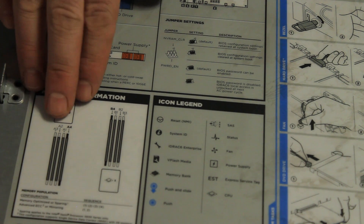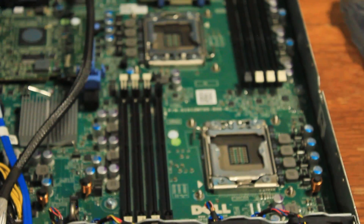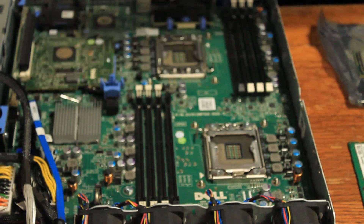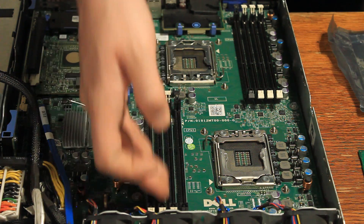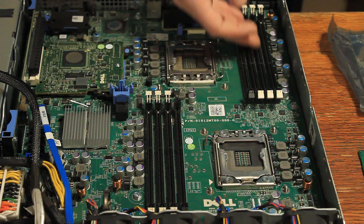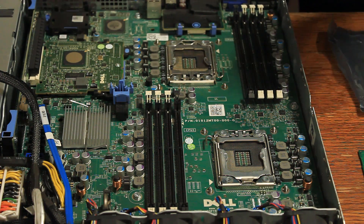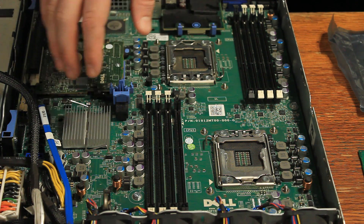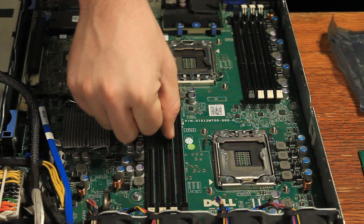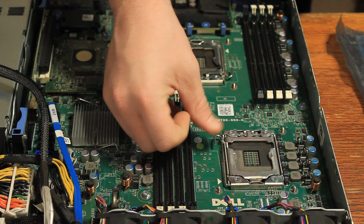For this exercise I'll be filling A1, A2, B1, and B2. Removing the lid and taking a closer look inside the server, you can see the diagram was spot on - we have the black rail A4 followed by A1, A2, and A3. Over here we have B4 followed by B1, B2, and B3. Right here we have CPU socket number one and CPU socket number two. We'll install CPU1 first, then CPU2, then heat sinks, then RAM, giving us a total of 16GB.